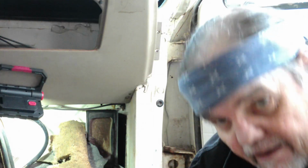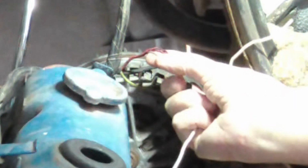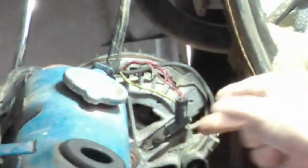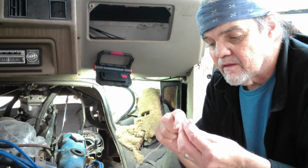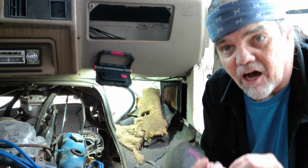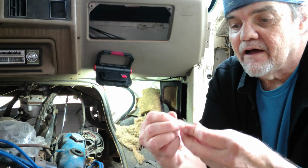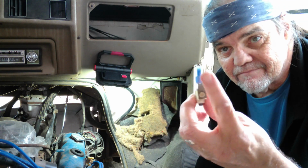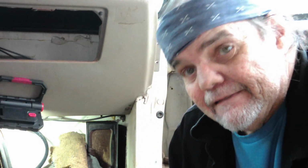The other part is going to splice some of this wire right here into this wire right here. We're going to have to cut this off. Probably, say right about there. Cut the insulation and cut that. And then I think we'll have enough to put a splice in, attach this into the splice, and then give us an inch or two and attach this connector on the other end. And this connector will fit conveniently on the connector of the brush, right like that. Push down a little further actually. But it's snug and I don't want to get it on there too tight. Okay, that's the plan. Nice and simple. Let's see if we can pull it off now.